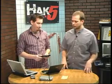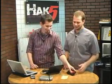Because the access point can see them, you need to be close enough so that the client's getting the deauth packet. Exactly. And this only has a wireless radio capable of sending, I believe, 2 megabits per second. It's not very powerful. So you basically need to be sitting right beside the person. It's a fun toy. But you're better off using something like, hey, somebody tripped over this and de-authed your wireless. It's like unplugging your network card by accident.